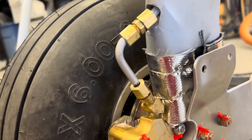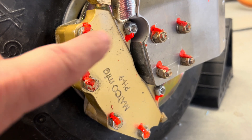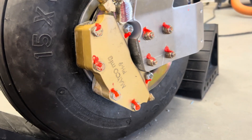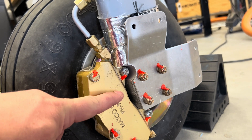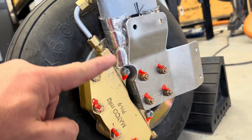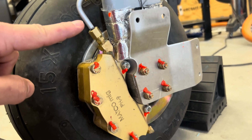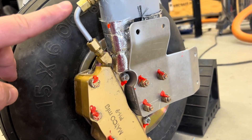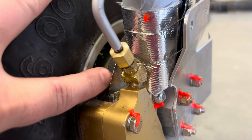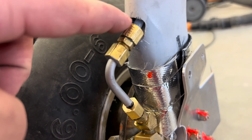The things that I did different: I added the upgraded Matco brakes. It's a double piston brake so it's bigger. Normally the brake piston would stop about here and then you have this tube which would go from here into the old hole into the gear leg, and the piece that Sling provides would work. A side effect of getting the bigger brake calipers was to get this separation here, and I assume Sling's thinking is to get the heat from the brake rotor as far away from the nylon brake line as you can.